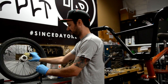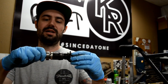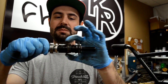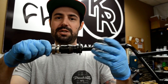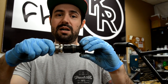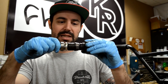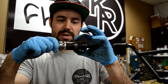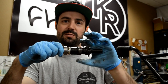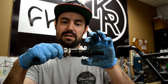You can set the wheel to the side and see how everything came apart. Alright, so this is how a free coaster works. When you are pedaling, the cylinder comes in towards the driver and it engages the hub shell — it's pushing into the hub shell tight enough to where it turns the hub, and that is how you go forward. When you go backwards, the driver slightly moves backwards and you can see the cylinder moves back away from the driver, which also means it moves away from the hub shell, which allows the hub shell to roll freely just on the bearings.